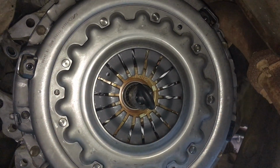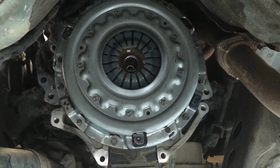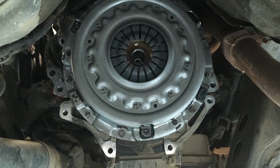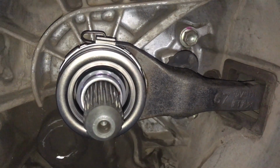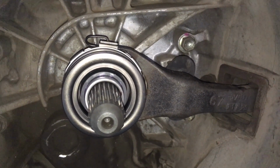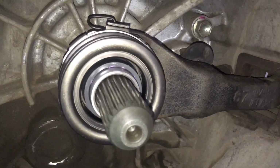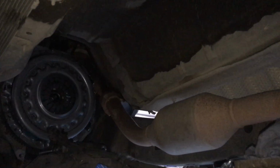All right, pull that plug. Now we can put the gearbox back in. So a quick tip, if you've left it in neutral, now is the time to put it in gear, because that looks to me like it's time to go in. And when you want to align this spline, you want to be able to, at the back, give it a bit of a twist. Right, she's going in. Look at that, I'm providing the light on the job. Ah, you're useful for something.